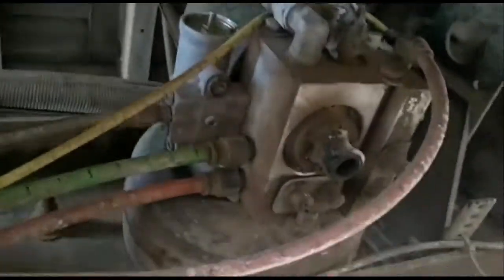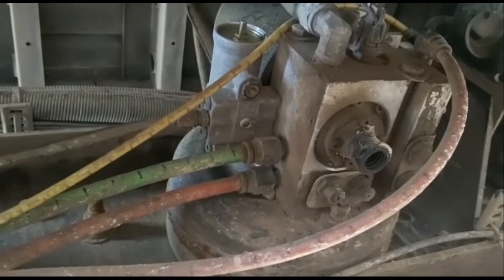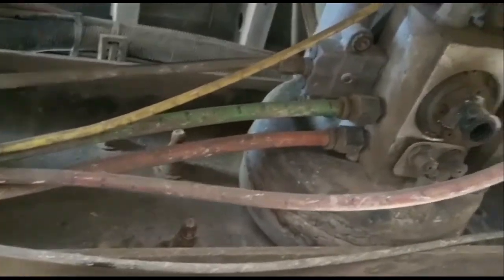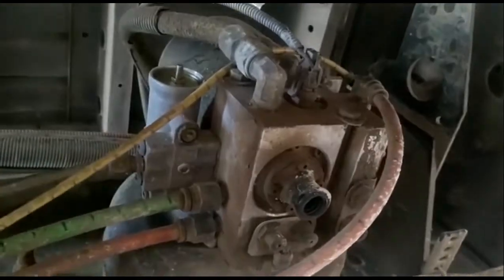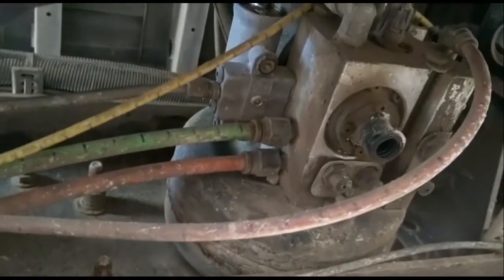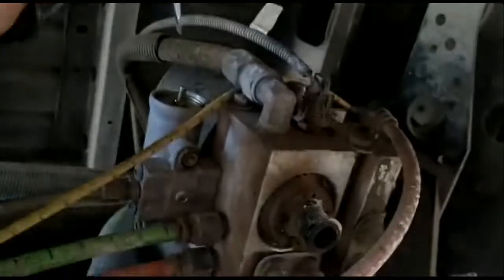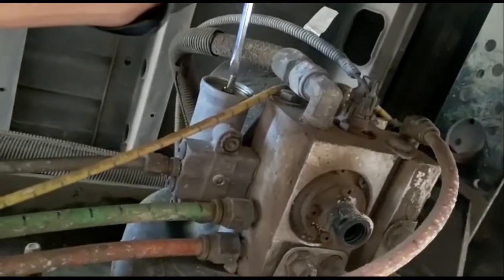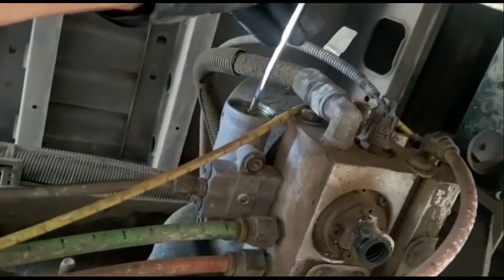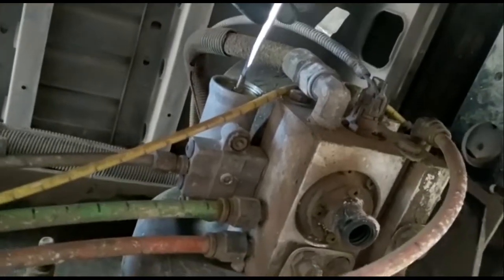So let me continue. So I went up there and I cranked the truck up. It's not as far as it was. So what I may have to do is actually adjust it a little bit more. I had a half turn. So I'm gonna put it at the three-quarter turn. So that was a half right there. So I'm gonna bring it up because what happened is I can hear it build up to about 125 or thereabout, and then the dryer would just blow off.